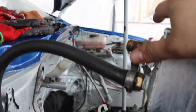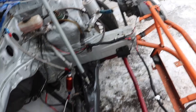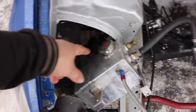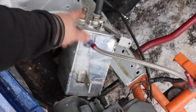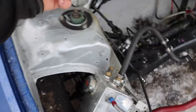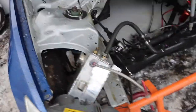I don't know yet — I have to see once I get the Wilwoods installed how it's gonna go. I was also thinking I could mount this little baby here somehow. The rad doesn't have a coolant cap — it's on this thing. He fills the whole coolant system through that. I think these were the fittings for the coolant lines to the turbo and return from the turbo, and these were going to the heater core and back of the engine. This is a little overflow that goes to the rad. Pretty cool system honestly.